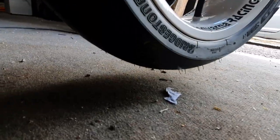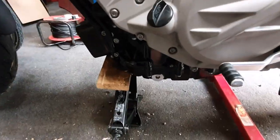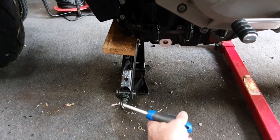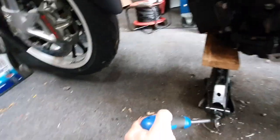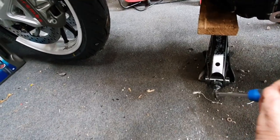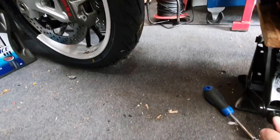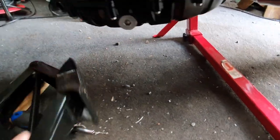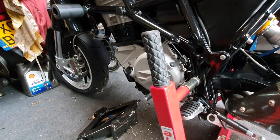And the back wheel is still off the ground, and this ABBA stand is still sturdy. You can put paddock stands on as well - you can do what you want - but the whole thing's off the ground. You can get these scissor jacks from car boot sales or second hand off eBay for about four or five quid. Let it down again - because it's not taking much force and the bike's quite light, get a sturdy scissor jack that'll take something like a transit van. And you're not messing about with straps and things, which is a bit easier. So I hope that helps - thank you.